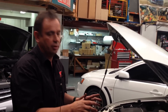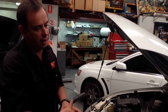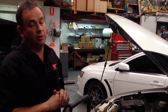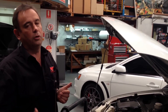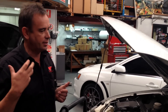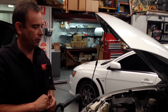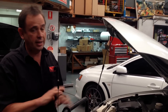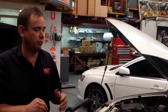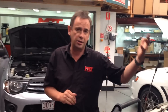The 3.2 litre engine was well known for EGR problems. This particular car has got 150,000 kilometres on it with the original owner and he's complaining about engine stalling, light throttle problems, excessive soot, smoke, and lack of power. When we have a look inside this inlet manifold, I'm not really looking forward to what we're going to see — being the original owner, he tells me he's never had the inlet manifold off to clean, nor has he done any maintenance to keep the soot down, nor any tuning modifications to stop it happening.